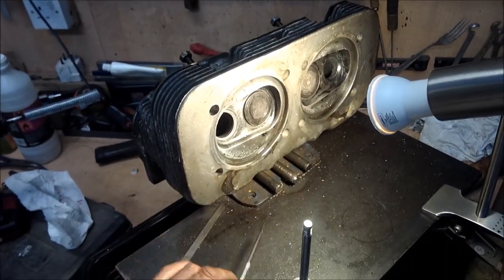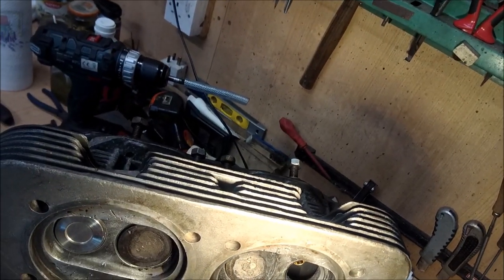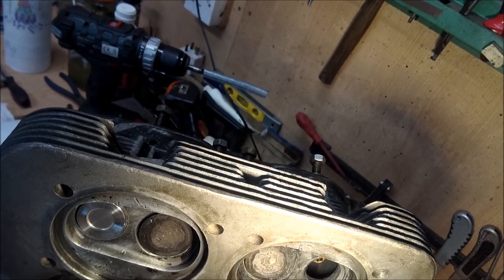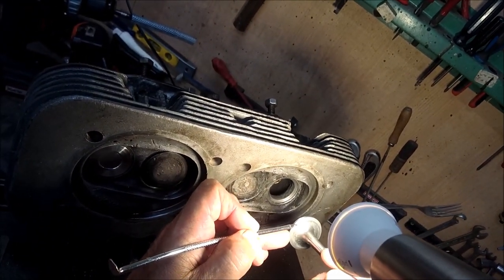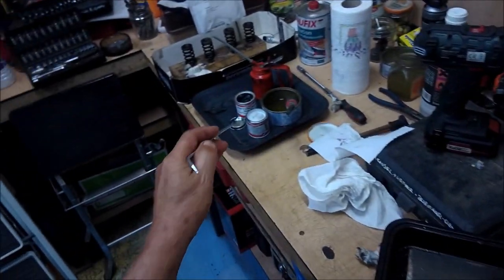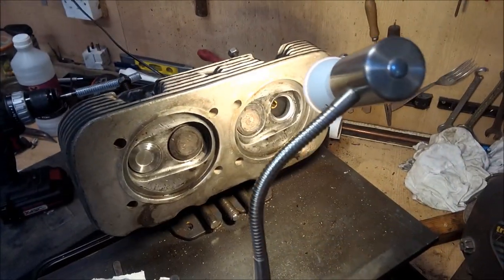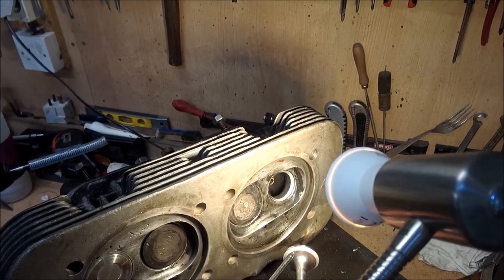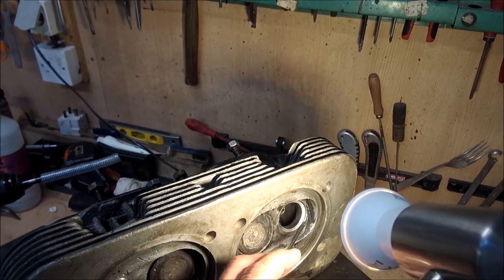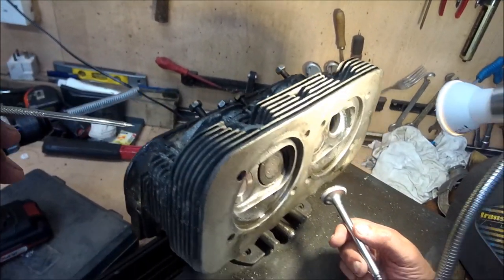On another sunny morning - we're going to do the second lapping of these valve seats. You can see it's got rings that go around - little rings from the coarse paste. Now we're going to use the fine grinding paste and that will take out the scratches. Just one pass with the fine grain - hold it into the light and as you can see it's now completely matte and smooth. Now we go and do the rest of the valves and then we can start looking at fitting the valve springs.